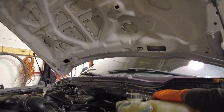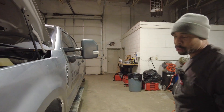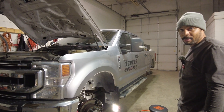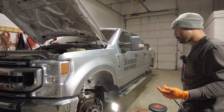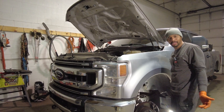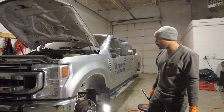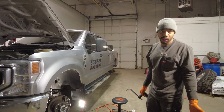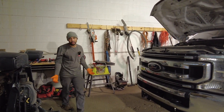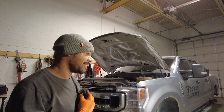It's not like I got any more out of opening the cap, so obviously re-secure the top. The only other thing I can say is if somebody came in here and added brake fluid — they topped it off to the max line — and here I come not knowing, compressing everything: it's gonna hit the lid and potentially cause an issue because it's too much pressure. Maybe the air just pushes its way out of that cap without a problem. It does seem to allow you to compress with the cap closed, so maybe I was wrong.